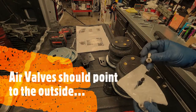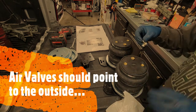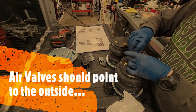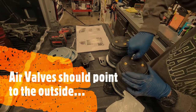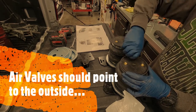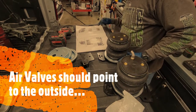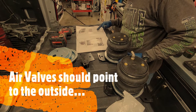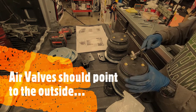Next, you're going to grab your air fitting elbows. They already come with some sealant on them, which is cool. It's going to go into this one here, and the instructions say to just do it finger tight, which it swivels, and then 1.5 turns. I do believe, let's see, tighten it finger tight, and an additional 1.5 turns. And everything's 13 on here, which is good.